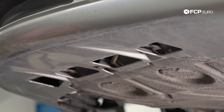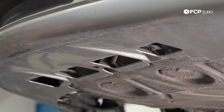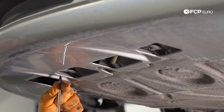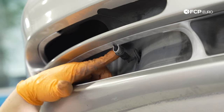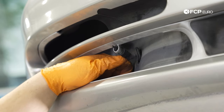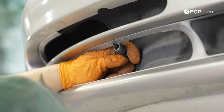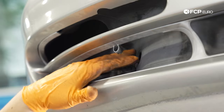Now we have both sides at the same spot. We have a couple more things to get to — three pieces of hardware underneath the bumper, just Phillips head screws. Before we pull the bumper cover off, we do have a temperature sensor to address on the passenger side. We're going to go ahead and disconnect it so we don't damage it when we pull the cover off. To get it out, just pull it from the bumper cover and set it to the side — it'll sit in the air dam.